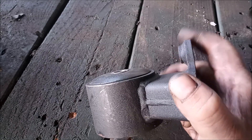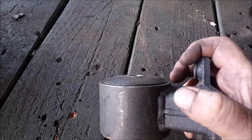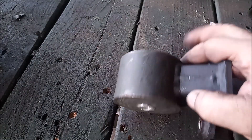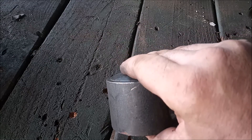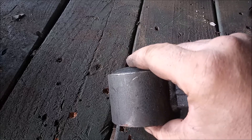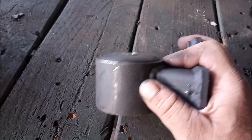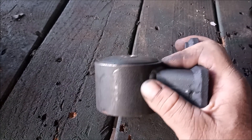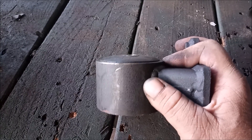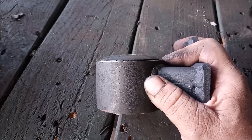The way this mount is constructed, the center mounting tube does not come in contact with the transmission mounting brackets. Instead, the rubber parts of the mount are sandwiched in the transmission mounting bracket, which leads to the mount being essentially loose in the bracket — and that's what causes the excessive noise, vibration, and harshness.